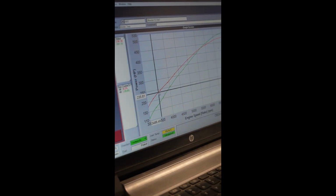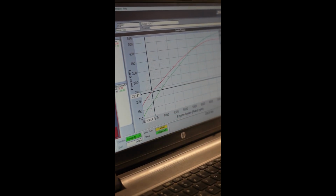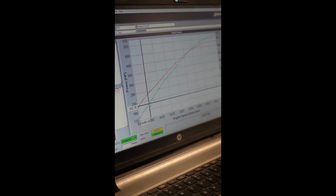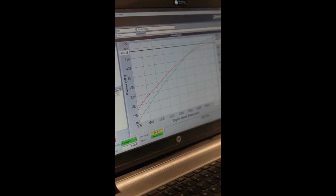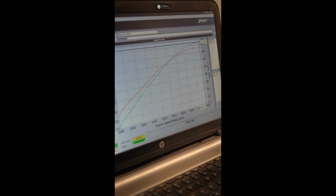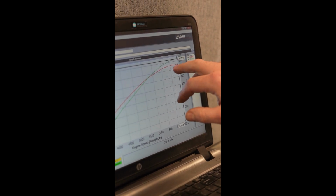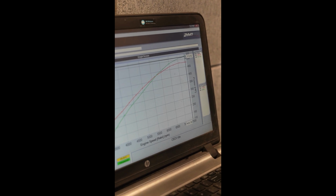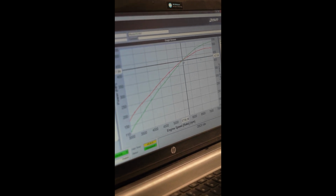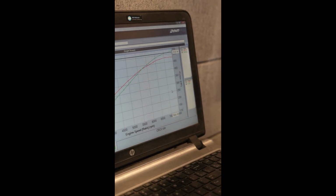Right, so I'm just onto the power, guys. It's made 35% more power between 3 and 3,500 RPM, so it's about 238 horsepower, and before on that line it was about 183. We have lost a tiny bit in the very top end. As you can see here, it's about 480, and it was around 515. However, what you have to remember is that's roughly 5.5 psi more boost pressure to make that. So we have made gains all the way up to 5,700 RPM, all at less boost pressure, and we've only sacrificed this very small amount right on redline.